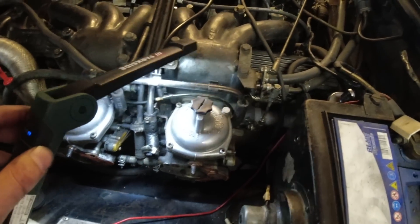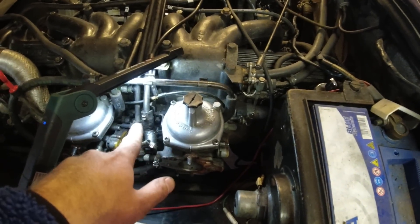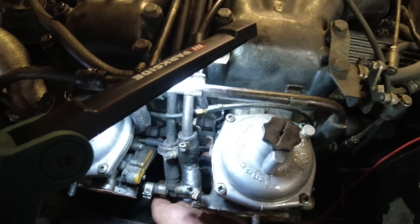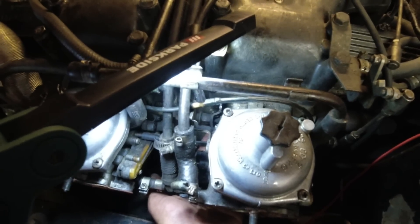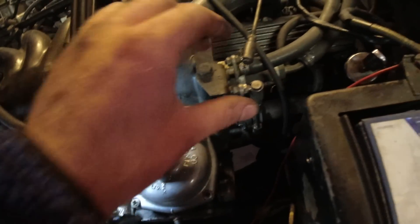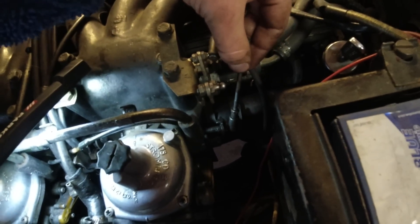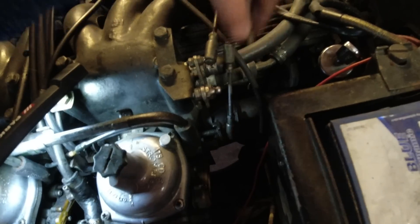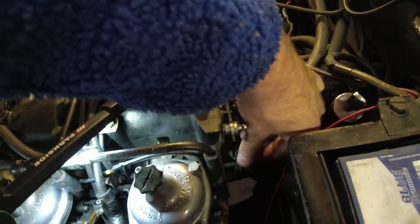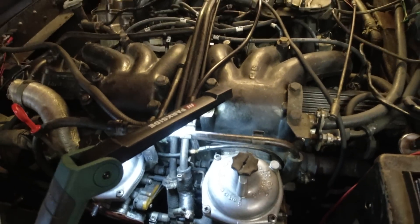After a lot of checking, I found what the issue is. There's something wrong with the throttle linkage on this carb. If I have these two completely backed off, they're not connected together - they're completely at stop idle. However, if I move this one, I can get it to move quite a bit. For some reason it is not going completely back to idle, and all of this is loose. That was it - this one is just too far adjusted even though it felt loose. Now everything is fine. I'm going to leave this disconnected for now and we'll get that on there later. Now I can go back and set everything else.